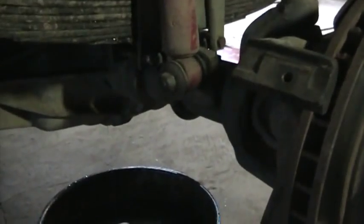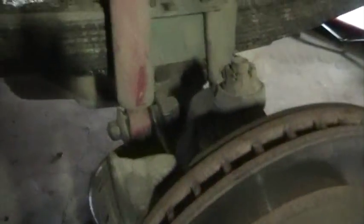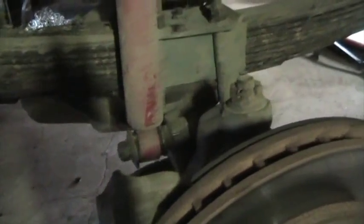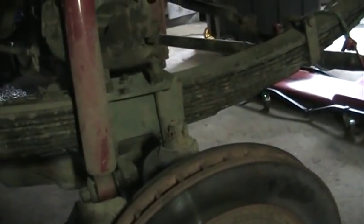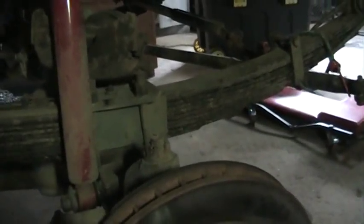After the install on the axle, that's where I ended up with my shock mount, and it's not too bad. The angle's off a little bit — if you look at it this way, you can see it points down a little. That's because I didn't have my caster correct, and I ended up shimming to get my caster to the right angle, so the whole front end didn't swing left and right when you turn the wheel. It's pretty highway friendly now.